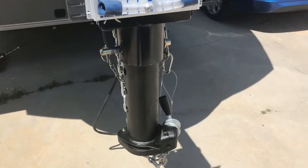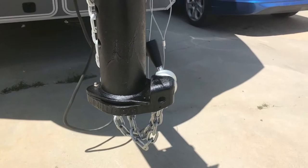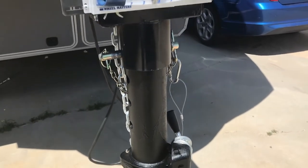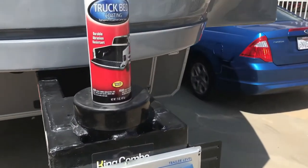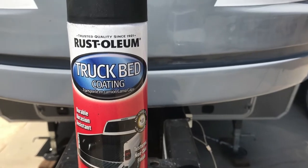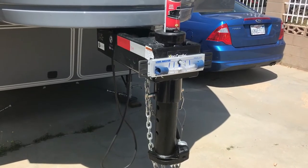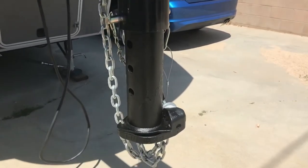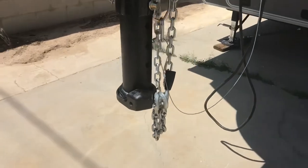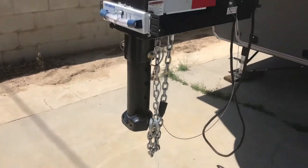The reason I'm changing this is because in my truck I use a gooseneck hitch with a turnover ball receiver. One real bad thing about this particular hitch — again it's the Bulldog BMX — it comes bare metal. But one good thing is it centers the ball as it's pushing up into it with a kind of cone shape underneath. Before I put it on I took some Rust-Oleum truck bed coating and painted it. It doesn't have the shine the rest of the frame has, but it is coated.